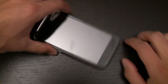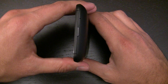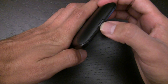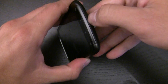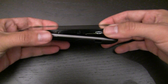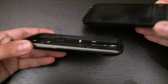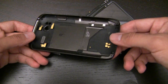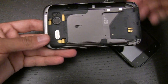The next part is how do you get the phone out. There's not so much a battery cover on the Sensation as there is a way to take the phone out of its exoskeleton, as I call it. There's this little tab here which is spring-loaded that you can press in, and then the phone pops out a little bit. It lifts out, and because this part is hooked over, you then pull it out. This one big metal piece serves as the battery cover, the whole case, the phone's primary structural element, as well as a place for all the antennas — which is of course what these gold contacts are for.